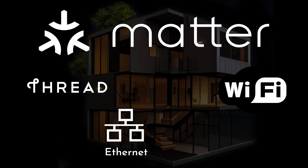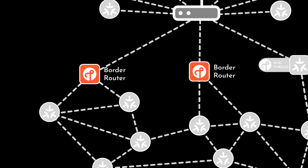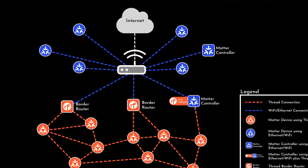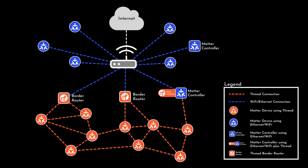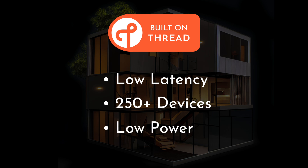The second thing you need to know about Matter involves hardware. Matter supports Thread, Ethernet, Wi-Fi, and Bluetooth, although Bluetooth is just used for device setup. Thread, unlike Zigbee and Z-Wave, doesn't require a hub for translation. You just need a Thread border router or a Matter controller with Thread built in to connect your network of Thread devices to other Matter devices as well as the internet. You can have multiple Thread border routers working together in your home, which can make the network more reliable. Because Thread is IP-based, Thread devices can directly communicate with Wi-Fi and Ethernet devices, making Thread very fast with low latency. It also supports up to 250 devices on the network and supports low power.